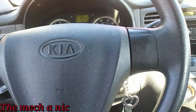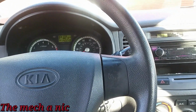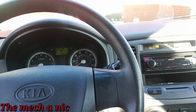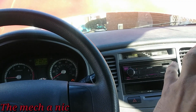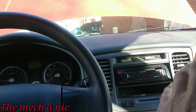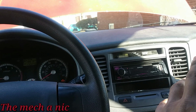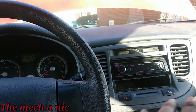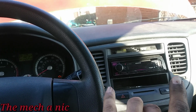So it looks like the owner is going to want to go ahead and get the work done that I recommended to fix all the clunking noise and the noise we have while driving. So she's going to take it right now to get a new tire put on it, and then we're going to order a new wheel bearing, because to me it sounds like the front right wheel bearing is making noise, and it makes sense because that's the side that had the messed up tire. So that lump on the tire puts a lot of stress on the wheel bearing and could cause it to fail prematurely. So I hope that makes sense. We're also going to take care of the stabilizer links and a complete set of front struts for this vehicle.